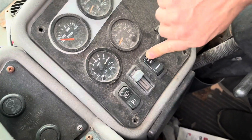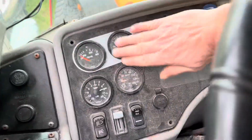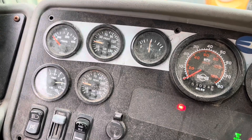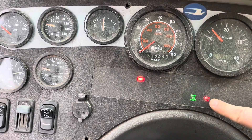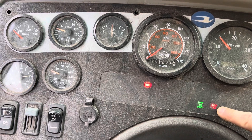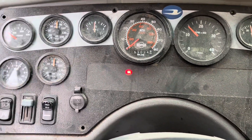Do the test — you can watch our air pressure build, and about the time these gauges get to 60 PSI, this light should go out and the beeping should go away. No, it just turned off at 70 PSI — apparently that's where it's set in this particular bus.